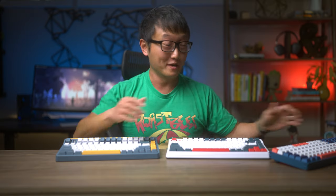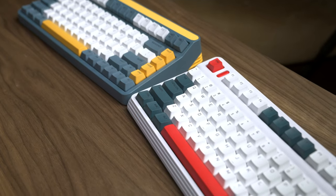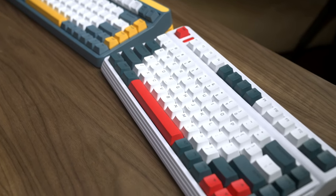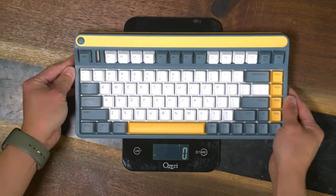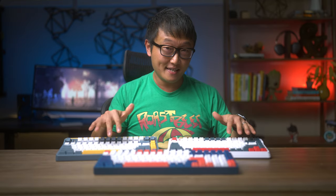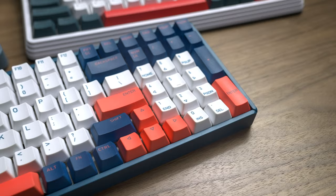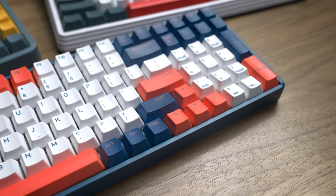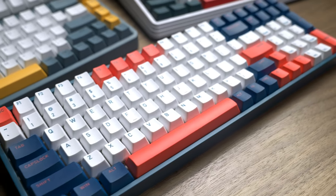These keyboards are really well built. The case on the F96 is made out of aluminum, whereas the 80-series are made out of ABS. All three feel equally rigid and heavy — they all weigh well over 1 kg, there's no flexing at all, and they don't move when typing. All three keyboards have PBT keycaps, so they're not going to look all shiny and greasy after a couple months of use. Just take a look at the F96 that I've used every single day for a year and a half — none of the letters have faded and there's no discoloration. These still look practically brand new.